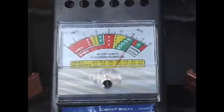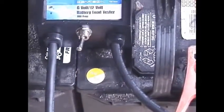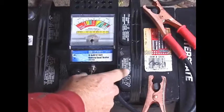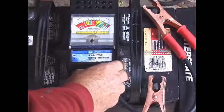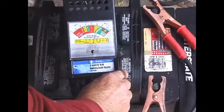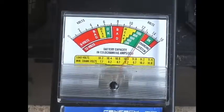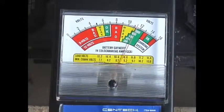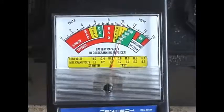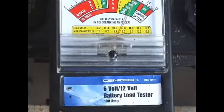The battery here is from August 2004 — it's been sitting in the pile for a bunch of years. It's running at about 12.3 to 12.4 volts. When I put the tester on it, it's over 600 cold crank amps — so that's good. This battery from 2004 is currently at about 12.8 volts. We're going to hit the load tester. You can see it's running at about 800, taking some of the surface charge and dropping, but sticking above 600. So that battery is good.